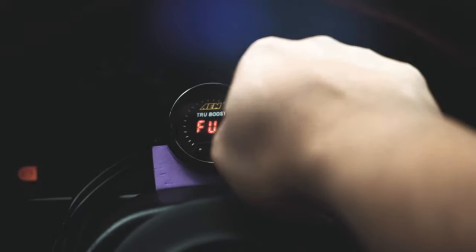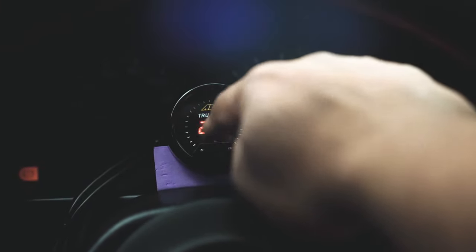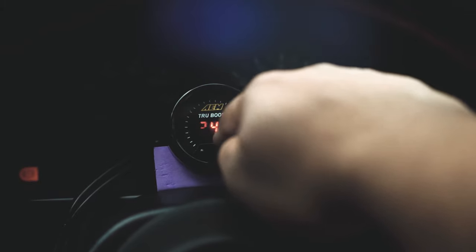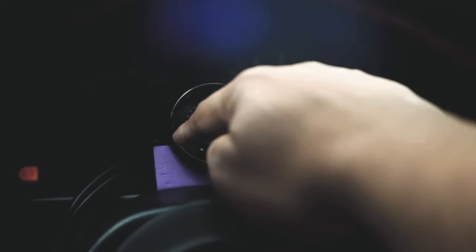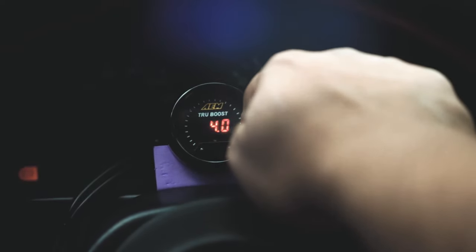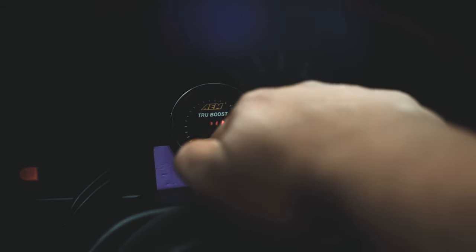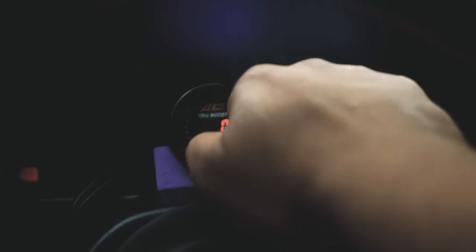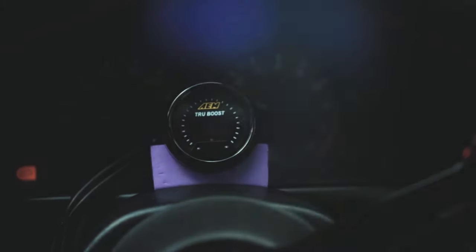Full is the graph display — how long you want the scale to go. It's in two increments of 24. I'd like to be at 20 so the whole display doesn't light up at low boost — at 10 PSI it will read around 10 out of 20. But I want it at 20 so that at full boost the whole thing lights up, and the moment the whole thing lights up it goes red because the alarm kicks in at that time.